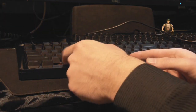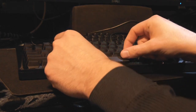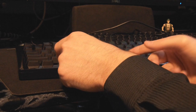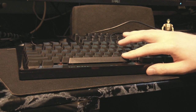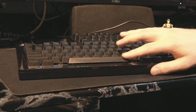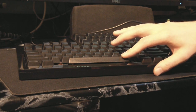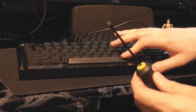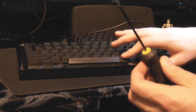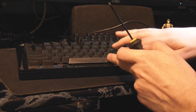Now the key is loose. What you want to do is just kind of work it a little bit — push it back like this — and you're going to expose the underside of the key. What you'll have here is a metal bar that is slid into two plastic tabs on each end of the key. Someone said use needle nose pliers, but I found that a flat screwdriver worked much easier. This one here is just the right size to fit in there and bend the metal out of the way.